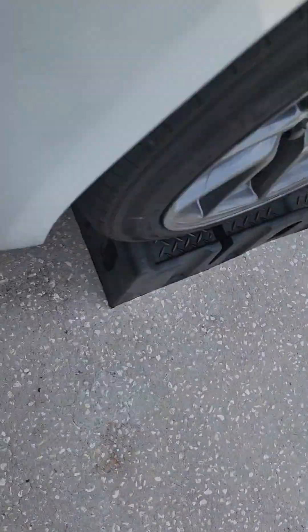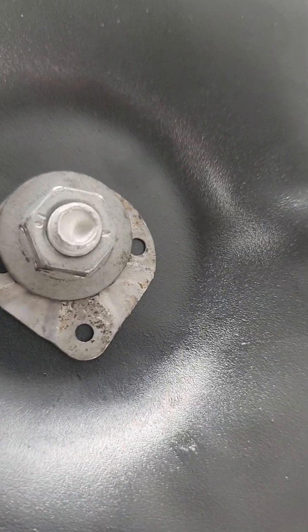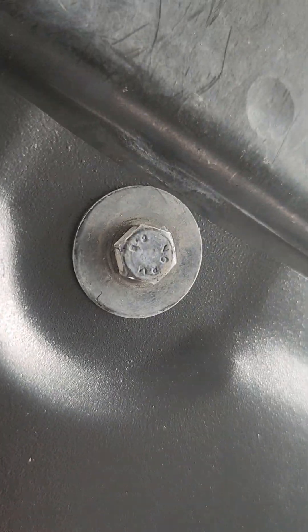Let's put this back together. Here's the inside of the skid plate, and just like the rear skid plate, when you get it delivered it comes in two pieces with fasteners to connect it — the seam is right down the middle. There's the inside of the would-be oil filter access if you had the dual motor. So you have an oil filter access panel you don't need on the front, and on the back skid plate, well, you do need it. To recap: all bolts are 10 millimeters except two — one on the passenger side and one on the driver's side, which are 15 millimeter. The metal washer from the original plastic was reused. You have four bolts across the back with two 15 millimeters, then four bolts in the front plus one in the center.